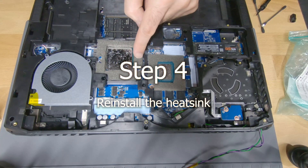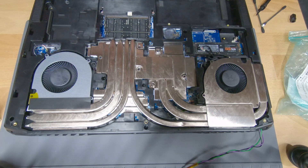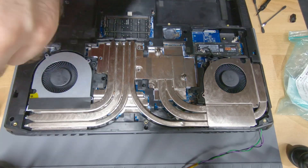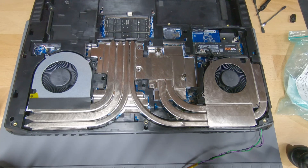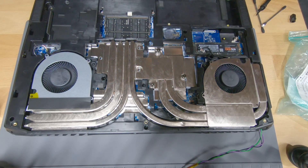Step 4: Install the heatsink with liquid metal. Now that I have the foam, the isolating conformal coating, and the protective nickel plating on my heatsink, everything is prepared for liquid metal. It shouldn't short anything, and it should not be able to migrate into the heatsink's copper and dry out. It should stay where it is and keep its properties even after years of use.